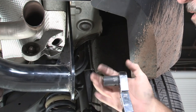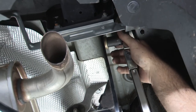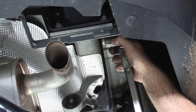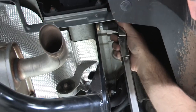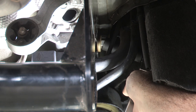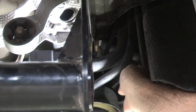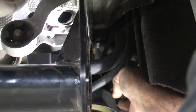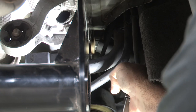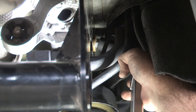We'll move over to the passenger side. I'll start with the most rear bolt because the one next to the filler tube is going to be a little bit tricky, so we'll get this one done first. I've got my torque wrench set in there with a long 11/16 socket, and I'm just trying to wedge it over the bolt there so I can torque it down. It looks like I can't get it completely on, but I can get it enough to bite to get a proper torque. There we go.